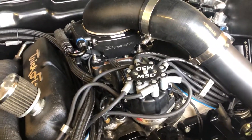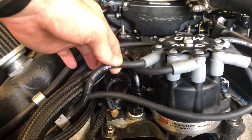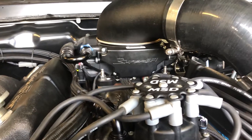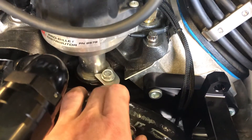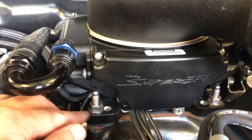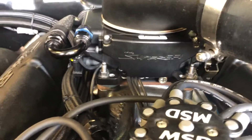If you're getting RFI and you've already done the normals: a bunch of people don't have issues with random spark plug wires, but I run MSD 8.5mm superconductors — I read these were the best for RFI suppression. Two, make sure you have good grounds. My distributor gets good ground through this bare aluminum plate to block. Make sure that's grounded well. I also made sure my hardware is making contact to the Holley itself — it's painted, but I'm making contact on one of these studs so it's getting good ground. I don't have an air filter, but some people have issues with the filter coming over the top. Maybe make sure it's grounded — you can always pull the air cleaner to see if that fixes your RFI issues.